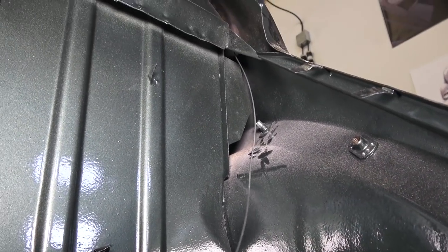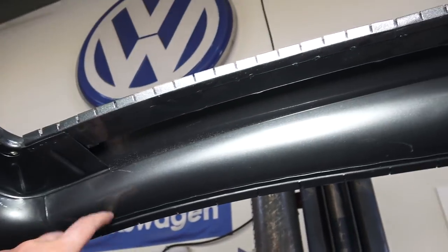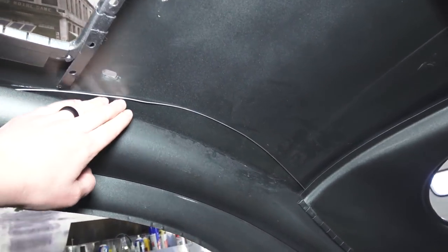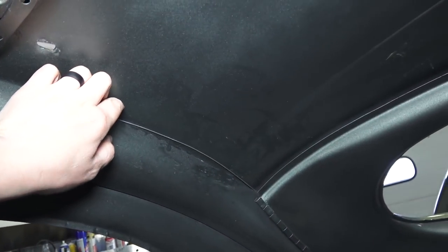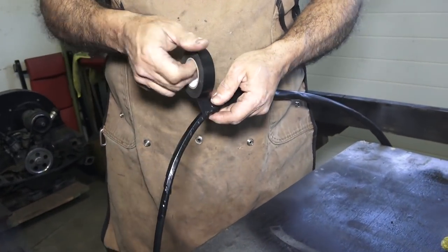Just make sure you look at your wiring harness diagram and confirm you're feeding through the right side — either the right or left side of your car. For a '56-'57 oval like this, the loom goes up into the overhead pillar. You can see the metal wire there; it fishes down to the back engine compartment. We fished it from the front and pushed it to the back.